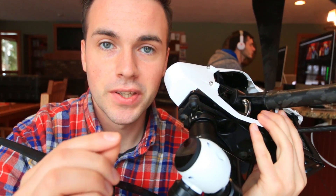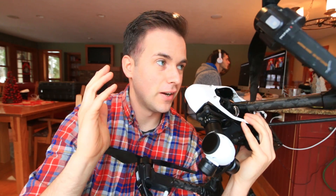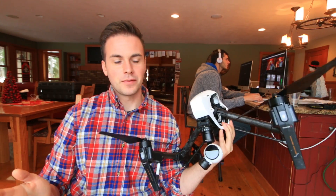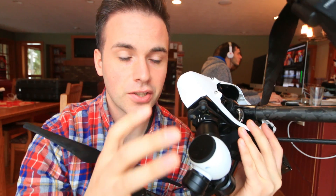When I went to update the firmware on my drone, I put the .bin file on the SD card, popped it in, and nothing happened. I researched every forum I could find, watched every YouTube video, and even talked to guys at DJI to figure out what I was doing wrong. This whole process took me about four hours before I figured it out. The problem lies in the DJI reading your SD card. They say you can reformat the card on your computer and pop it in with the .bin file — that's not exactly true. If your SD card isn't formatted correctly so that the drone will even read it, there's no way it can run the update.